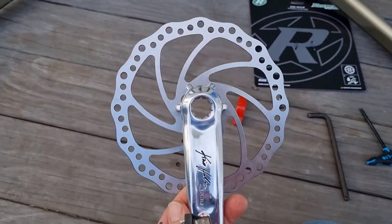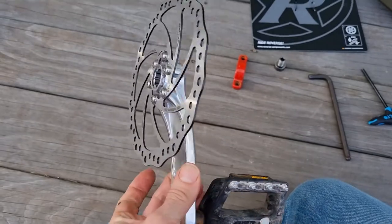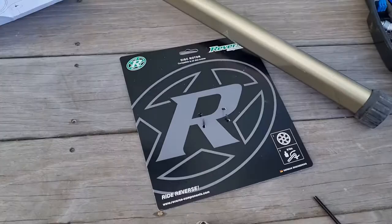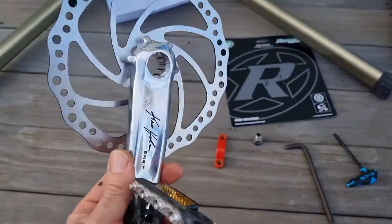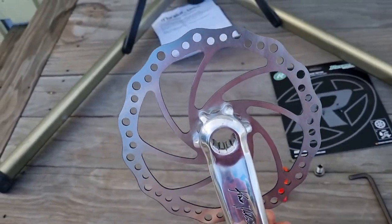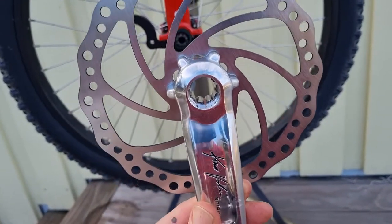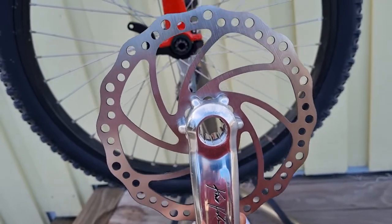So far I've pulled this crank off — it's the 137/117 — and I've screwed on a Reverse Components 180-millimeter disc. Of course it ends up backwards, so you don't get to see the writing on the disc, because with the Chris Holmes system everything goes on what is actually the wrong side for a disc brake, so everything ends up sort of backwards.